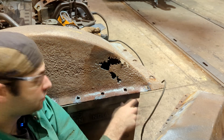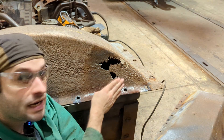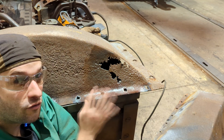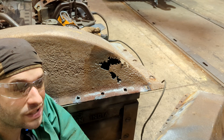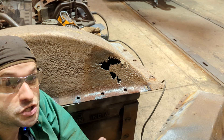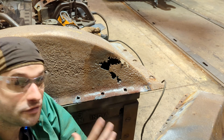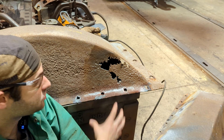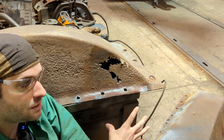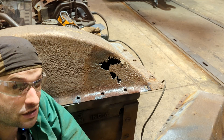Right here the metal's kind of curled up a little bit. I'm going to take my hammer and just tap this down and make it flat so I can get a true idea of where my lines are going to be. The straighter you keep your lines when doing patchwork the easier it is — it's easier to line up a straight edge than a curve or a radius because you have to cut out a new piece to fit. Remember, you're putting a puzzle piece into a puzzle; the less lines and the straighter they are, the easier it's going to be.